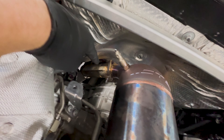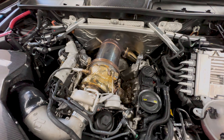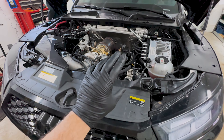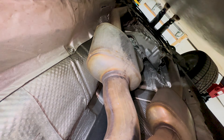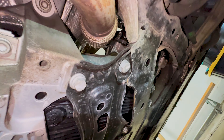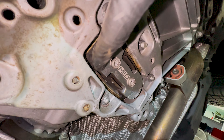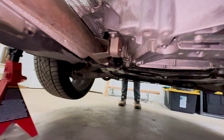With the hood open, the downpipe is fairly hot so we'll get to those bolts last. There are three bolts on each side, and since it's an upgraded downpipe it's just a bolt and nut, which makes it a little easier than studs. We'll spray with PB Blaster to loosen them up. Starting with the rear muffler first — there's a 13mm bolt here and one there. After loosening those we'll remove the exhaust clamps and also address the OEM baby resonators and mid pipes.